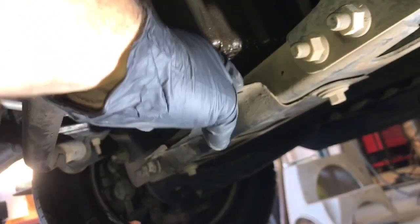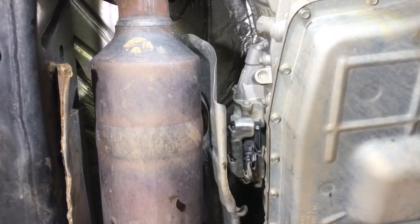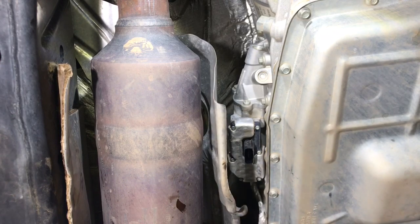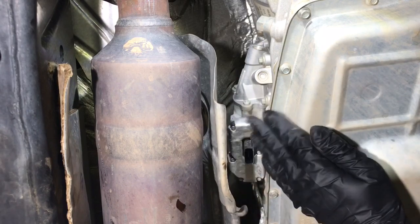Here we are underneath the truck. First thing we've got to do is remove the little dust cover using the 8 millimeter socket — there are four bolts, two in the front and two in the back. Once you remove that, we can gain access to the transmission. We're on the passenger side, and if we look at the catalytic converter, there's a heat shield there. The pump is just on the other side. You may need to bend the heat shield back a little bit to get better access to the pump. The first thing we're going to do is take off the connector — just squeeze the back of it and it'll pop right down. Then take an 8 millimeter socket and remove the three bolts that hold the pump to the transmission.